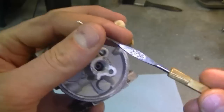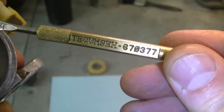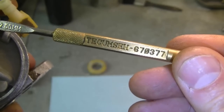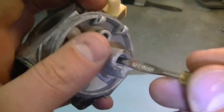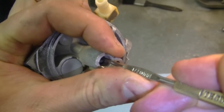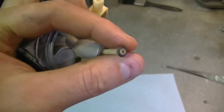For the next part I'm going to use my Tecumseh carburetor tool, which is part number 670377. You can also use a crochet hook if you do not have this tool. I insert the small hook right down inside the tube — I didn't go too far but I'm trying to get it up without damaging the tube. And there we go.